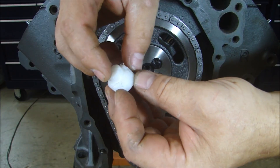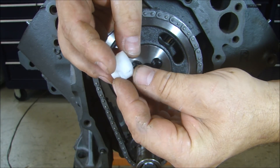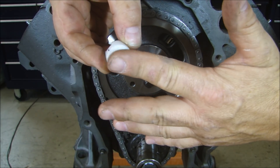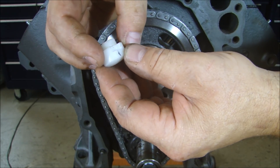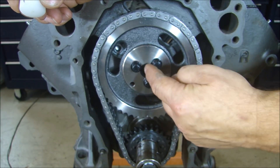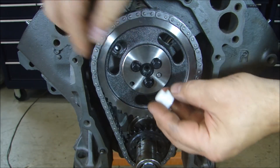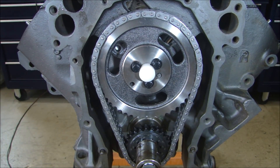Now the cam button goes in. This cam button looks like it's nylon and it's very easy to grind. We're going to use this because we'll have to set the thrust of the cam when we put the timing chain cover on. You can see how these bolts and washers come into the center of the cam — I had to mill out some slots in the cam button to clear the washers, so when I put this in here, it fits in there just like that.